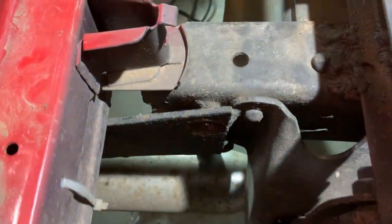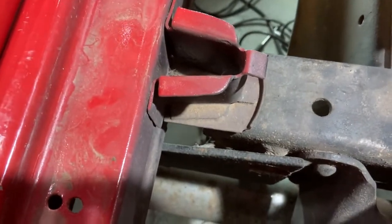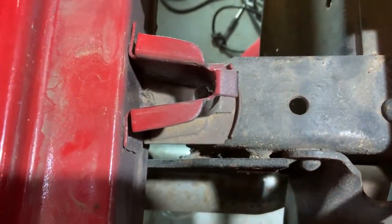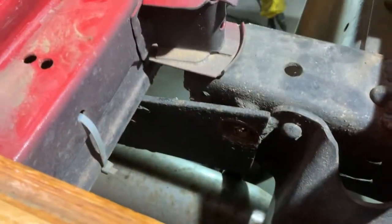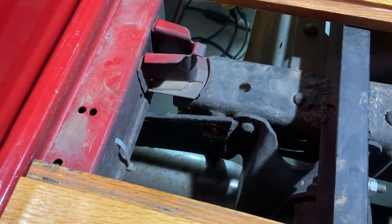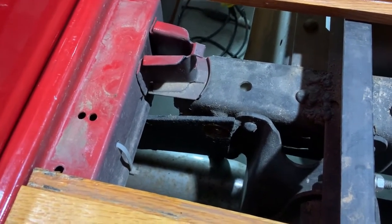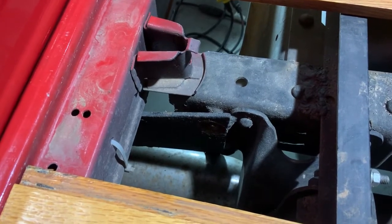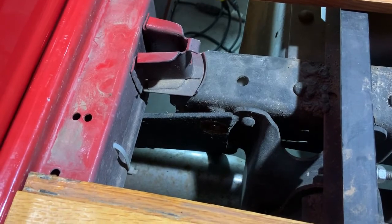And the bumper is kind of welded on there. That weld at the front is probably the strong one that's holding it, but it's spanning that giant gap. It's kind of welded over there, kind of welded over here, and kind of welded on the bottom. And originally I was going to just put some grade 8 3/4 inch bolts through it, but there's obviously not enough material there to do that. So I'm going to leave the one bolt on either side that was in there.